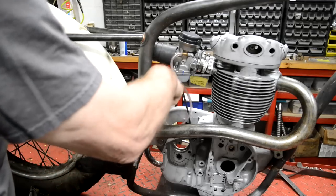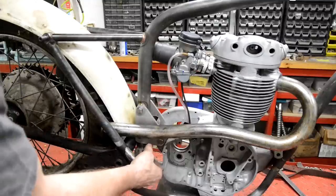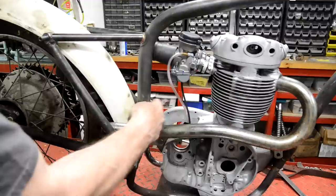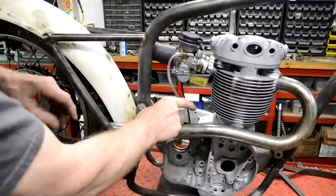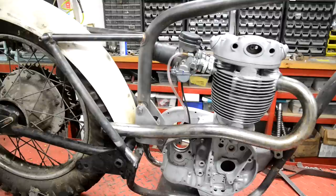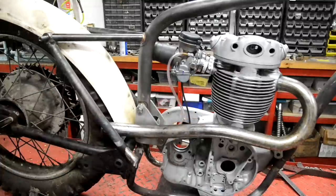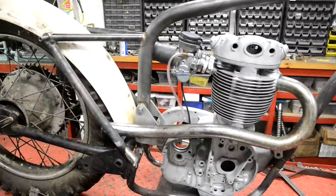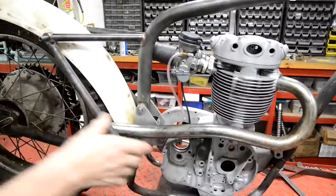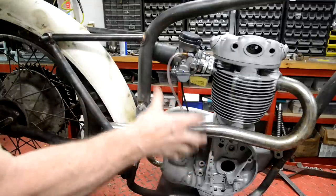I mean, it could even go down in between those plates down here. I've had some quick measurements actually, and if I make it go down there a little bit and one here, a bit wider here, there's 800 and something cc's, and getting to where I want to be. I've got to be careful, of course, on that side of the chain, and that's why I put this on. I need to be inside the exhaust, because of course the oil's not only got to lubricate the engine, but we need the oil to stay reasonably cool. It does cool the engine also, so we don't want it to be crammed in so that it gets hot.